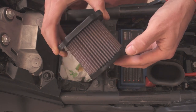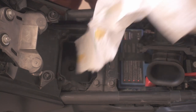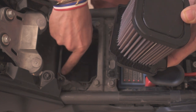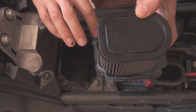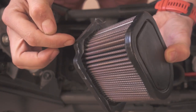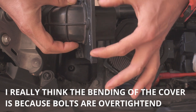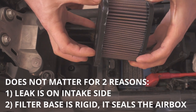Putting the filter back on the bike — there's no rocket science in that. This is how the uniform color looks like when I was talking about it — it's all nice pink-red. Now it's really just about making sure the air filter is clean and the airbox is clean. On this lip where the lip sits on the airbox, we put some grease. That would be the greasing done. With this filter it's not that important as with others because the rubber here is actually quite soft so it creates a good seal. Some people say that when you have these two bolts this one gets a little bit bent, but that doesn't matter because the filter base is really hard and those four bolts will actually push it very well.